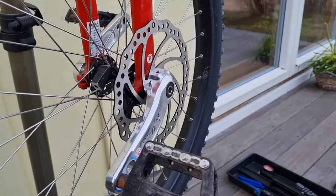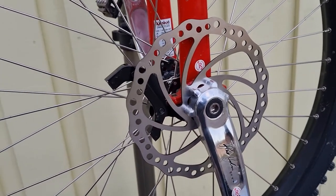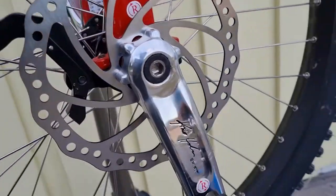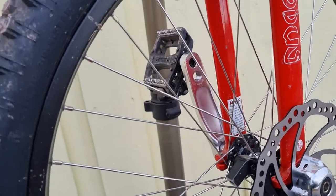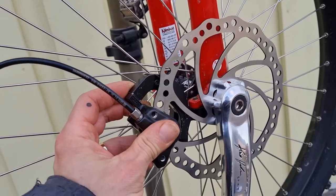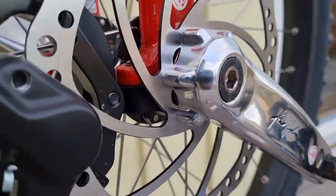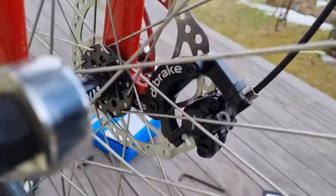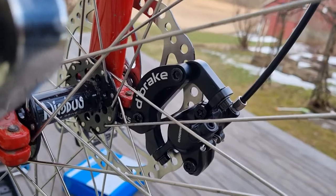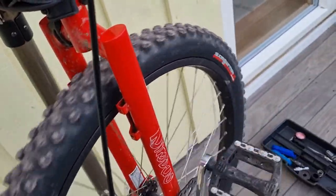After a bit of careful modification with an angle grinder, a file, and the vice — doing my best to keep it all square — I'm happy now that the brake caliper goes all the way in where it should go. So the crank is fixed back on, the brake fixed with the back bolt tightened up first according to instructions, the modified IS-to-post-mount adapter fixed on, and the caliper fastened down, centered, with the right amount of pad contact. Looks good.